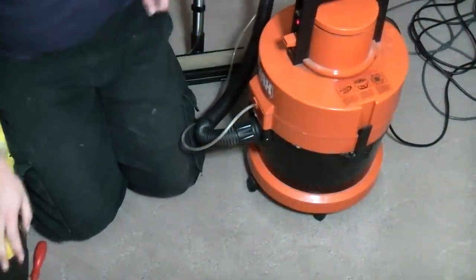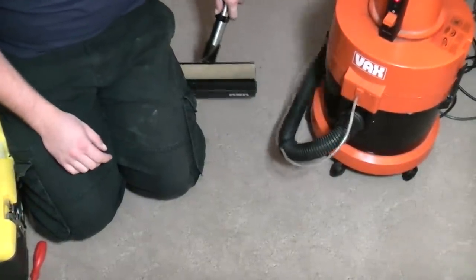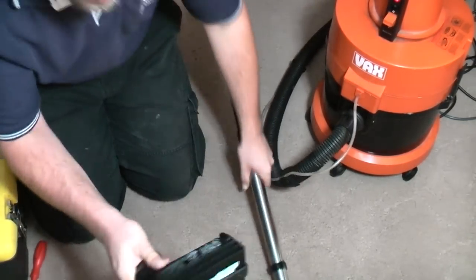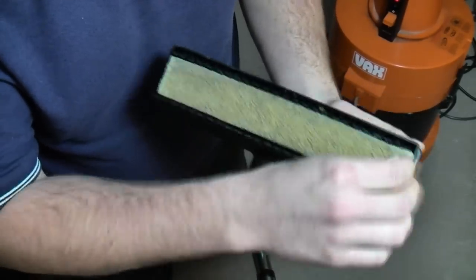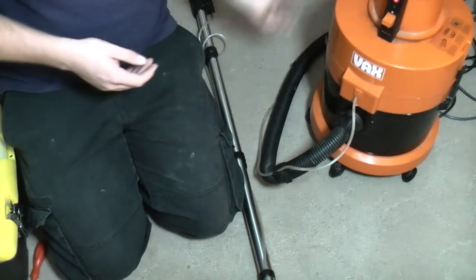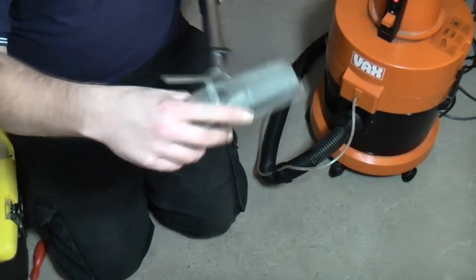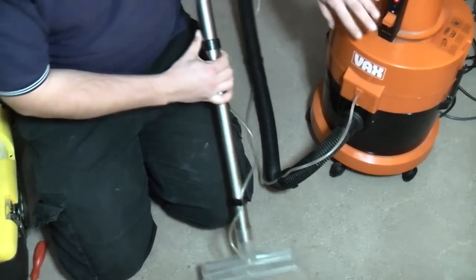I admit defeat. It does a good job. Eventually, take this off. Oh, maybe not that way. It's the front bristles that really do the work. Once you get those scrubbing, it does lift the dirt and then obviously squeeze it back. But it's just such a horrible thing to use otherwise. I had to have the machine up on the table again because the gravity feed just doesn't work well with that head. It needs this head or the other little one because obviously it sort of slightly pulls the solution through at the same time.